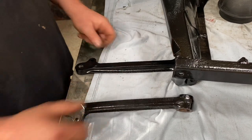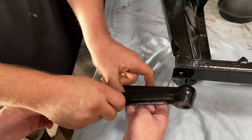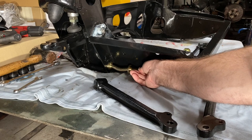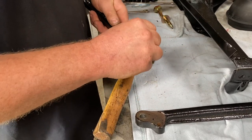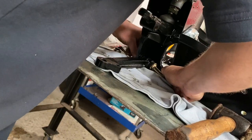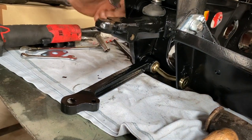The bottom arms were next. These are off the car and I'd previously cleaned them up and coated them. It's important to remember that these are sided and need to be fitted correctly, as the hole has a taper to allow the ball joint to fit properly. The lower arm pin is test fitted into the subframe, partly because the powder coating could have reduced the size of the hole and also because sometimes there can be damage from previous installation issues. The lower arms were fitted with new rubber bushes, which were a really tight fit. When tightening up the lower arm pin, a nut was placed on the end and tightened up which pulled everything in. The nut was then removed, the spring washer placed on, and everything was then re-tightened.